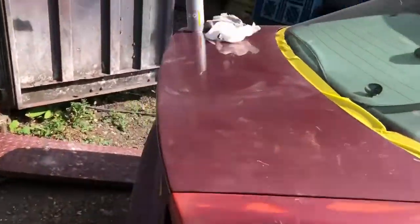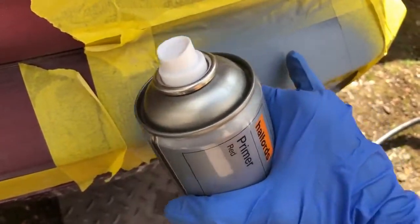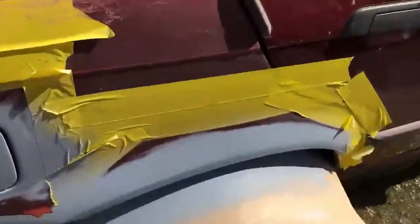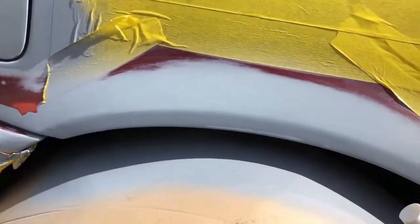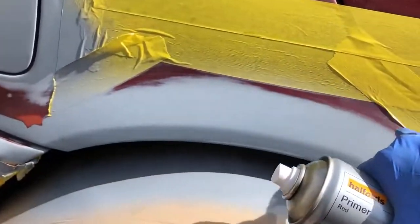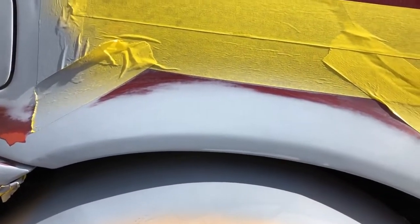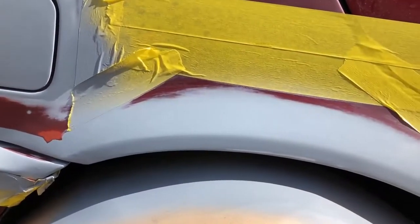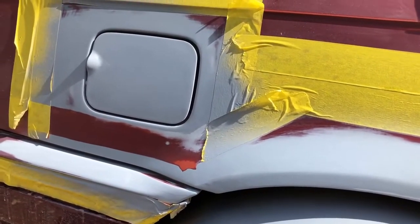I'm gonna get some red primer on now. The main areas I'm concerned about are where I was gonna spray — obviously covering a little bit of extra area, and also here, most of the exposure of the metal was around there. Not so much up here but just covering a section up to a certain point, then I can flatten it because the tape will create an uneven surface, but then we can blend that section into the rest of the paintwork and we'll be ready to spray.